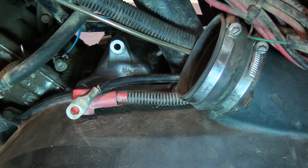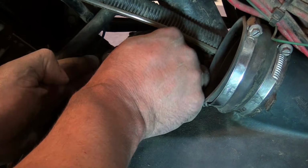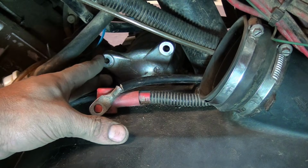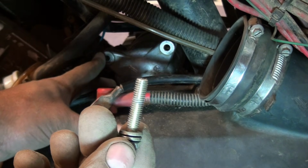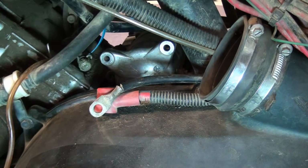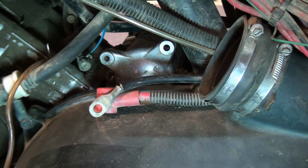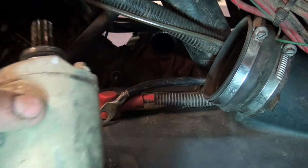Alright, so I just wanted to check in with you here, and you can see I've got the whole starter motor spun, and that's what I think it's going to take to get this out if you're not going to remove this whole clutch cover. This bolt basically prevented it from coming out, so I had to get the starter out far enough so I could actually get that to spin out. I might save myself a couple of headaches and put a shorter bolt in on reassembly,